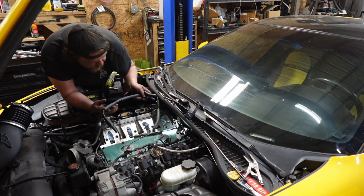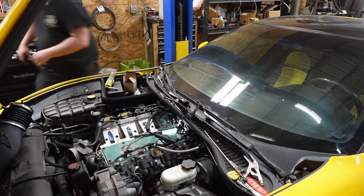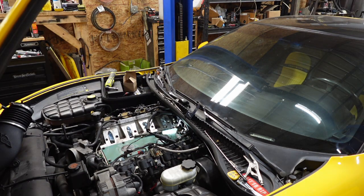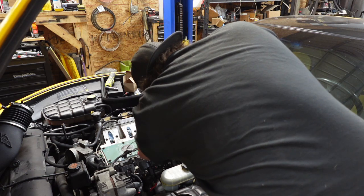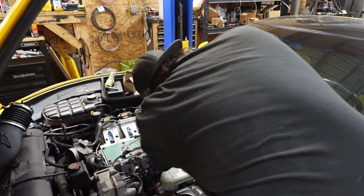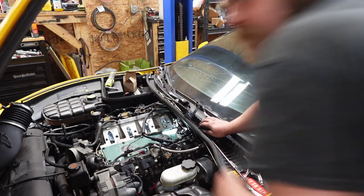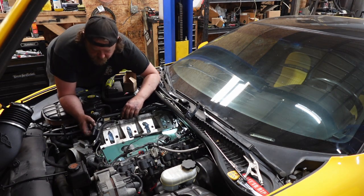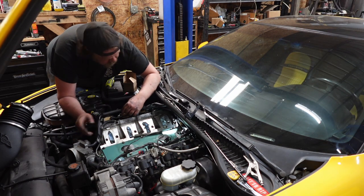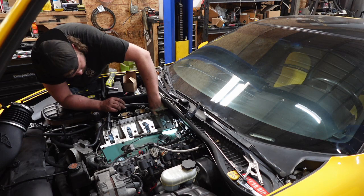We'll actually put it in to where it needs to go and then sneak it in, starting at the driver's side. It just gets pushed into the grommet. Like that. Now run along this side and obviously plug into the throttle body, or intake manifold. There's the ground screw. Ooh, it has a keeper on it too. Didn't know this was a thing. This one, wiggle wiggle onto here.